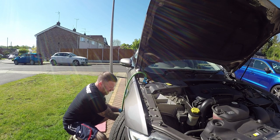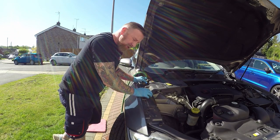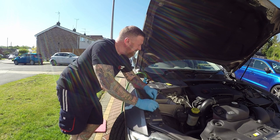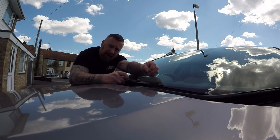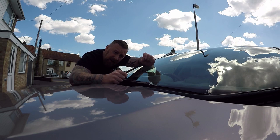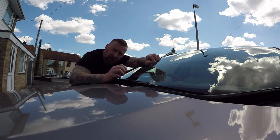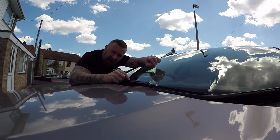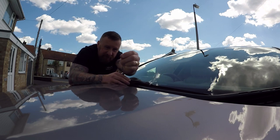Pop your finger in the hole, let it fill up a little bit, then let it pour out. Best thing to do when you've drained it — gets all the bits out of there as well. You will have a little bit in the pipe itself, so just flush it all through and run it for a while. Now remember, sometimes just poking a needle into the jet hole, giving it a wiggle round, and taking it out will fix the problem. But I had bigger problems because I knew my pump wasn't working.